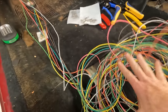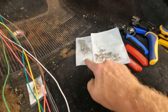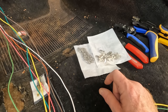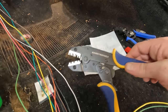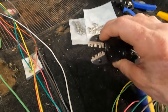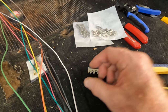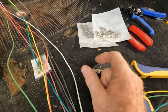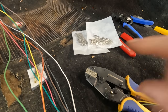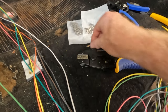This is all that's left — this is the taillight wiring. I actually had to pick up some more terminals. Not Painless's fault, just mine from ruining too many as I'm trying to get the hang of it. I did pick up this tool a while back — it's been really good. You're able to get the clip in there, it's the same shape as the terminals, and then you squeeze it down and it does crimp really well. You do have to pull them in a little bit, put that down in there, make sure the wire's in tight, clamp this down. Now that I'm getting towards the end, I'm starting to get a lot better at doing my crimps.